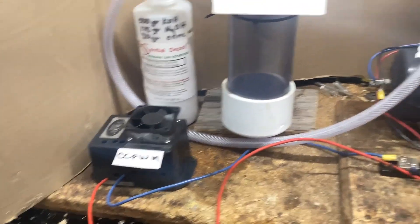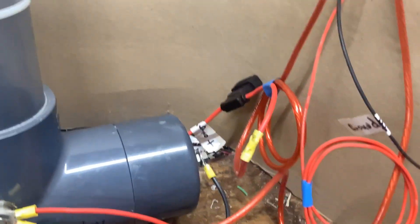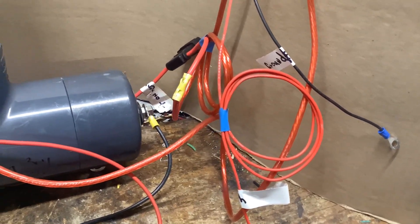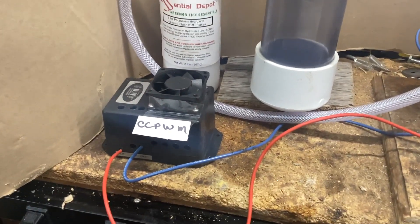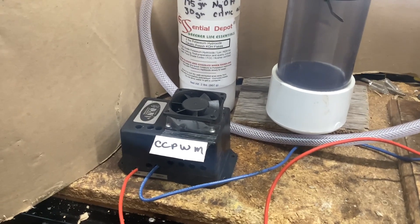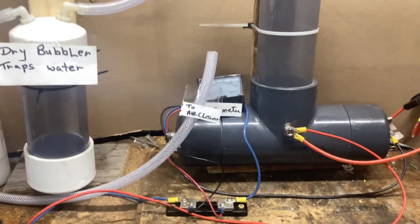That's one of Carol Mason's older ones before he retired. Over here I have a 30-amp relay. The wire over here with the fuse goes to the battery. That one right there is a signal that turns it on — something that goes on and off with the start switch. The bigger wire comes in the center; the little red wire goes over here and supplies 12 volts to the electronic circuit board inside the pulse-width modulator.